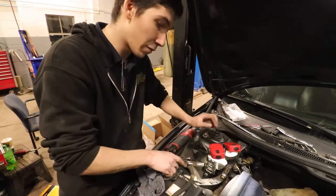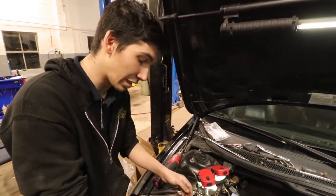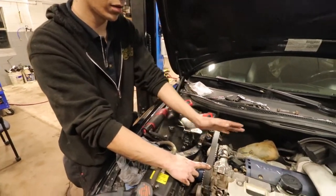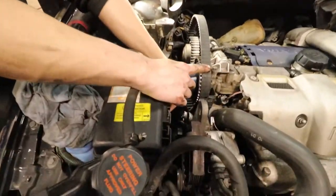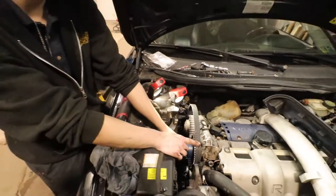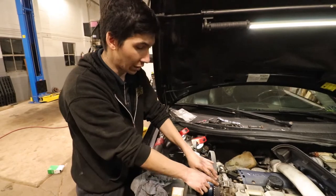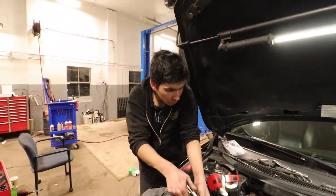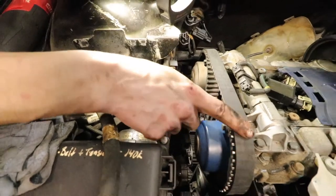To install the belt, we pull on that tensioner piece — I think it helps expand and contract with heat, but it lets you relieve tension to get the belt on and off. We removed the top cover since we know it's lined up. Make sure the intake side where the belt runs is as tight as possible because there's no tensioner there, only an idler — if you have too much slack you won't get the belt on or it'll be off a tooth. Use vice grips gently to hold the belt so it doesn't move on you.